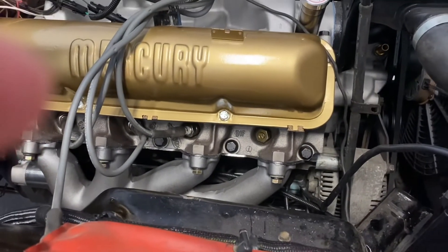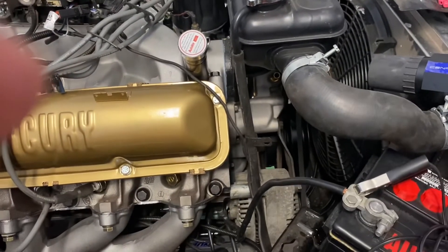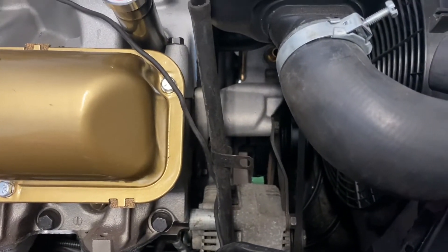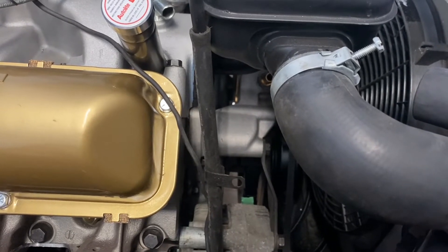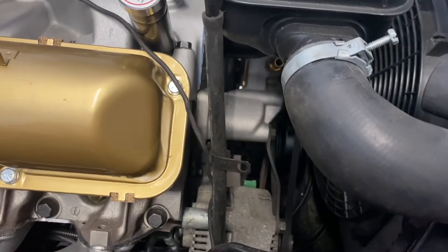So that will stop the piston coming up. Now I'm going to rotate the engine over by hand. I put masking tape on the balancer, which allows me to mark zero. Then I'm going to make two more marks when I hit the piston stop in both directions, and then we'll peel the tape off and I'll show you that.